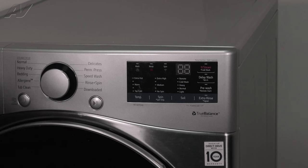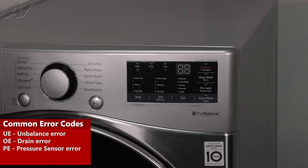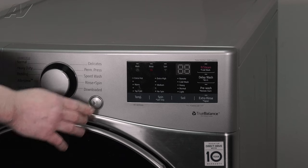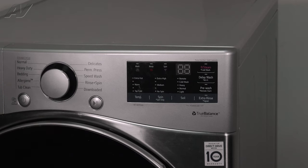As far as error codes are concerned, error codes show up on the screen when the unit has failed. The more common error codes you might find are UE for an unbalanced error, OE for a drain error, or you may even find a PE for a pressure error. When the error code is displayed, all you'll want to do is press start one more time — it will exit the error code and you should be good to go. But depending on the error, whether it's a UE or maybe a product failure, it tends to come back if there is a problem within the product.